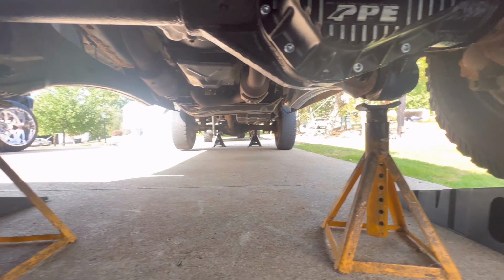So, wow. Look at that. Nice. So guys, per usual, we're using all the Motorcraft gear lube to go in the axles. 80 weight 90 is for the front and 75 140 is for the rear. You can find this in your manual, how much it takes, but obviously with these new covers, we're gonna have more fluid going in the truck.